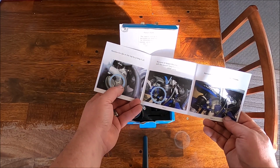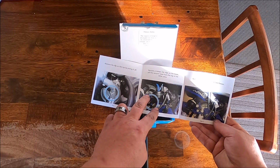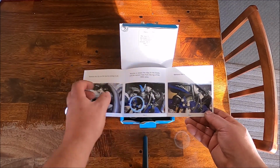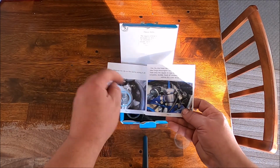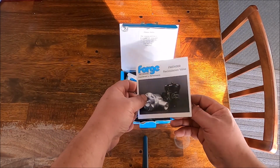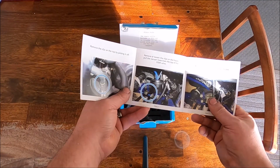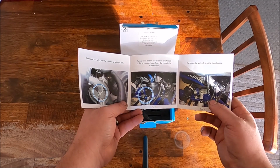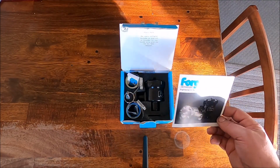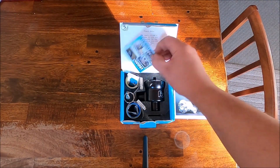It's basically saying take off the vacuum hoses off the top, undo the 2 ports to the original recirc valve, remove the recirc valve, replace with the new one. Piece of piss. They're dead easy to fit, anyone can really, but it's good to show you if you ain't sure, because not everybody's used to this kind of thing, especially when blow-off valves and recirc valves are often people's first modifications.